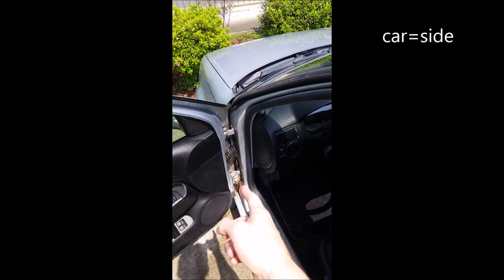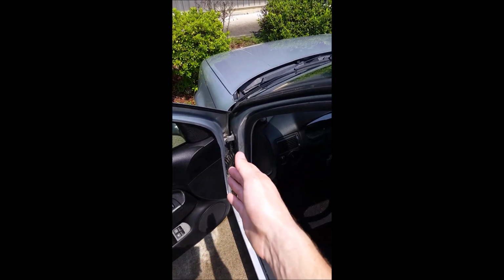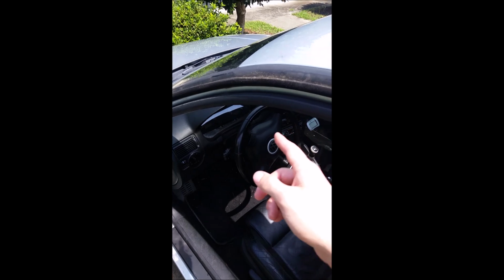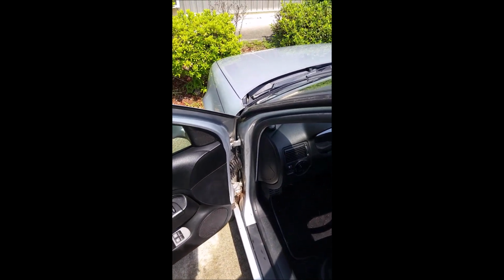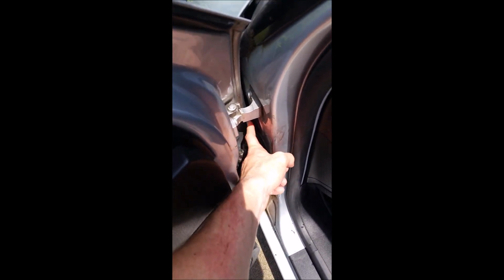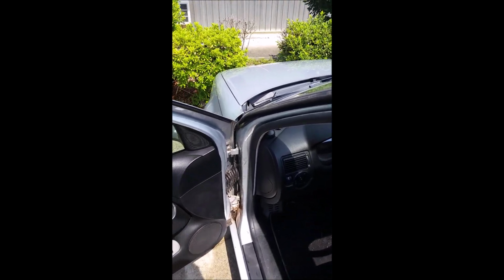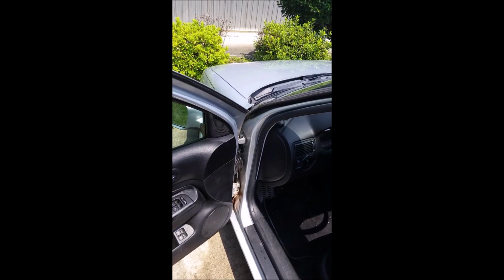And then I didn't have a symptom of water leaking in this car, but I also had a more occluded drain hose. So I wonder if this being more plugged up was making more go through the passenger side, which was making overflow my passenger floorboard more. But now I cleared it. I did the weed whacker wire loop, pulled it tight, ran my plug up, and then in testing the drain, it's now draining out there successfully. So it looks like I fixed this problem, and I hope that the next storm proves that to be true.